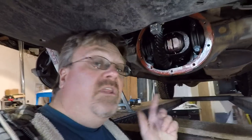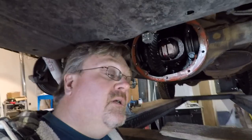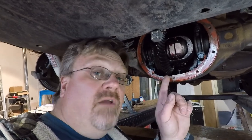I'm doing a final systems check on the used locker. Everything went together pretty smoothly. Instructions weren't bad, though a few places they used 'ring gear side' and 'left side' interchangeably. It was easier to read all the instructions, picture it in my head, and then just put it together. Everything looks to be bolted together properly. The gap between the two sides is right where it should be — spec is 145 to 170 thousandths, and I'm at about 150. So even with all these used parts, we're right in spec.